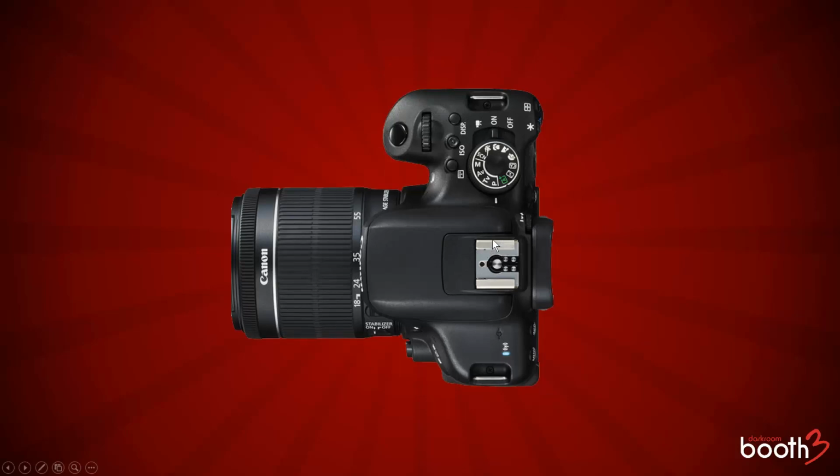On the top of the camera, you'll also see the hot shoe. This is where you would connect an adapter to plug in your external flash. If for some reason your flash is not working, it could just be that the connection is not making good contact. If you look here, these little silver spots are contacts that the camera uses to connect with the flash, and if it's not slid on there well or something, then it may not be making good contact. So you want to make sure those are making good contact.